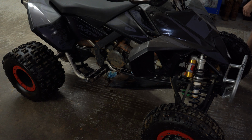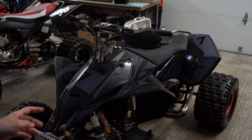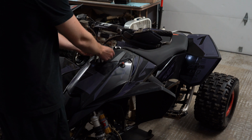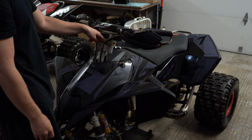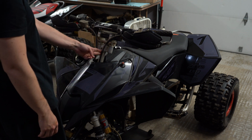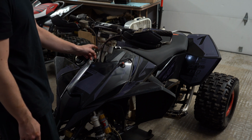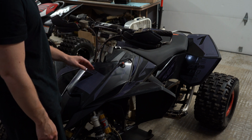See if we can figure out what's going on with the oil on the skid plate. Usually I go ahead and just clean it off, just get a fresh start. Alright, next up I think we can pull these 17 millimeters off. Almost all the bikes, they're always 17 millimeter because we got to get to this top cap. This is kind of unique to KTM. They have like a clamp that kind of just rides on the stem that uses a set screw. So kind of unique. I don't know about stronger, because Yamaha also went with the aluminum stem.